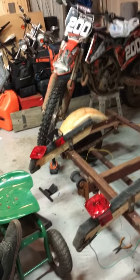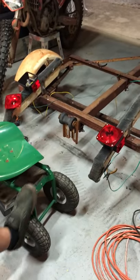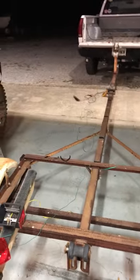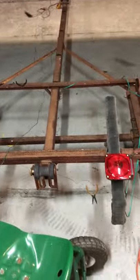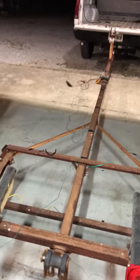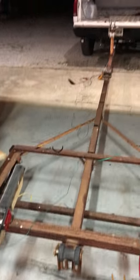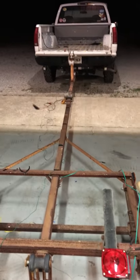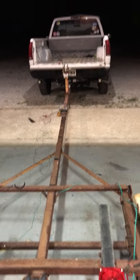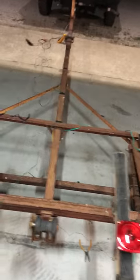So what was happening is these two trailer lights we just bought from Walmart — the brand is Blazer. Before we even put them up on the trailer, we set them on the back of the truck bed, cut the wires, put the wires together, hooked it up to the truck and made sure that the brake lights, the running lights, and both turning signals worked. They did.